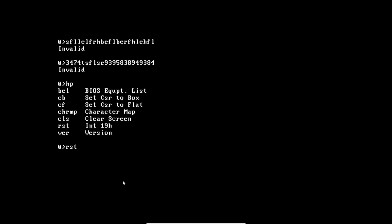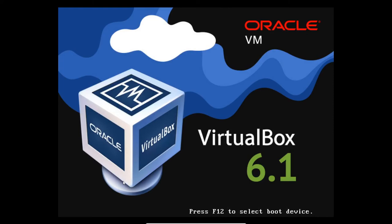And then RST. That triggers interrupt 19, which I believe when it's running on top of DOS, will just go back to DOS. But running in a virtual machine will actually reboot the system. Now, running it on real hardware, you kind of get a mixed bag. Some of my computers, they lock up. Some of them, they start booting Windows. Some of them, they actually properly reset. I think this is really meant for if you're running on top of DOS, which I'm not. But here, in this case, of course, it just resets it.